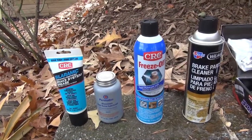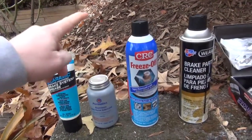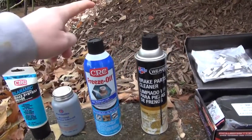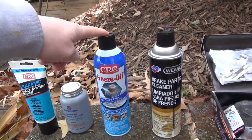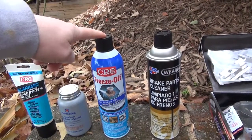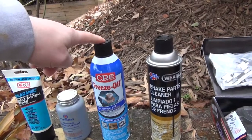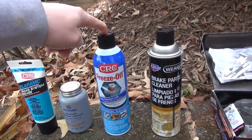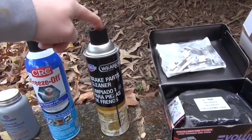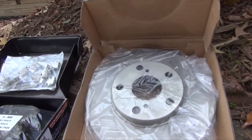There are some liquids you're going to need for this. You're going to need some brake grease, you're going to need some anti-seize, and you're going to need something that you can spray on those rusty bolts to try to get the rotor off. The rotor, once you get all the bolts off, is probably still going to be stuck, so you're probably going to need to spray something on it that will free it off. And then you're going to need some brake cleaner, your brake pads, and two rotors.